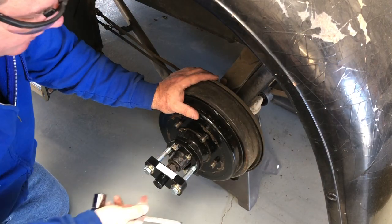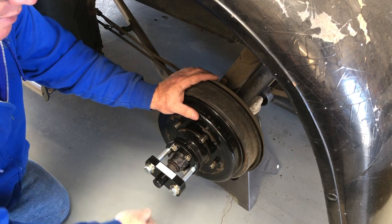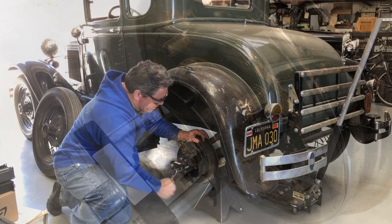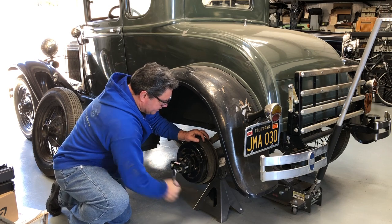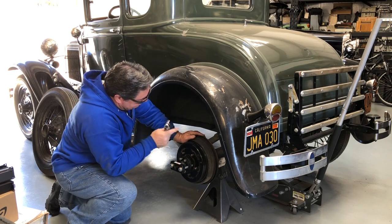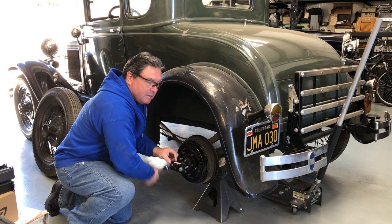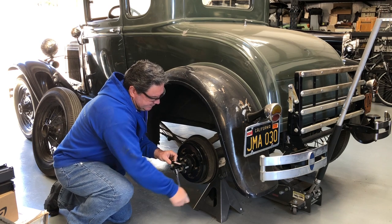It'll all be dipped. This time I didn't even have to whack it — just coming right off. Now this one is fighting all the way off. I think the puller is going to bottom out before I get this thing off all the way. I think it's hung up on the brake pads. The problem is I can't back the adjusters off — it's just so tight. I've got to get in there and clean this out before I can move the brake adjusters to back them off. But if I can't back off the brake adjusters, I might not be able to get the drum off. Is that a catch-22 or something like that?